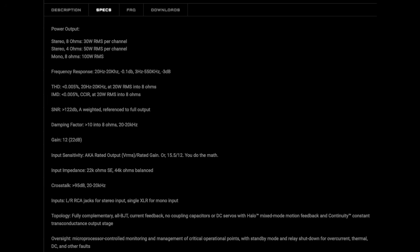A damping factor of 10 is a very low number. Damping factor is basically the amplifier's ability to control the movement of the cone in your speaker. A high damping factor makes for tighter, faster bass; a low damping factor is a little loosey-goosey. The original Asgard had a damping factor of 100, and so does the Vidar 2. So if you're hung up on that numerical way of judging an amplifier, you'd probably lean towards the Vidar.